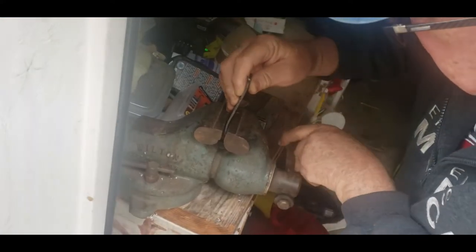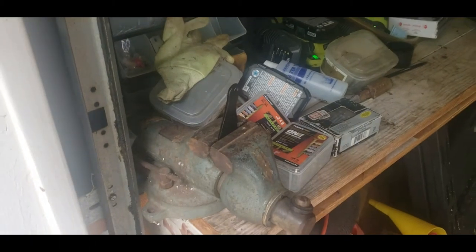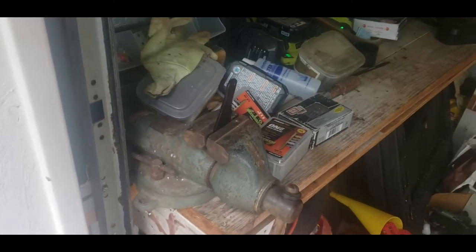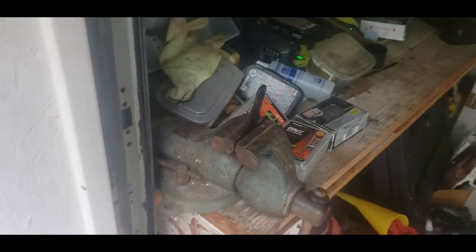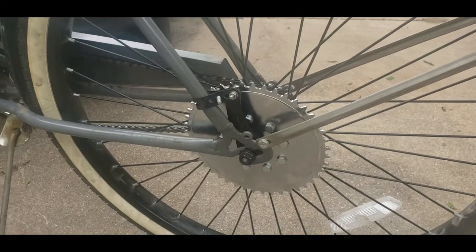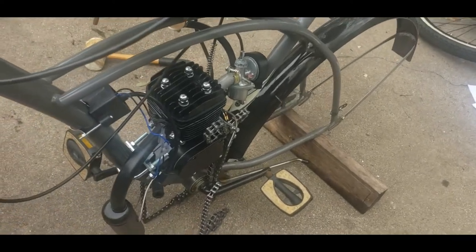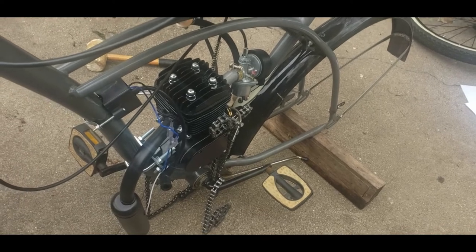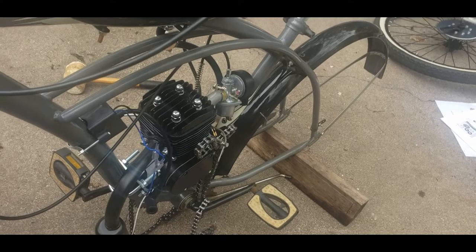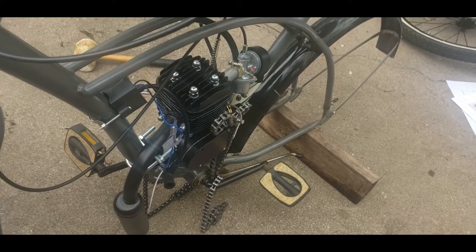As expected, we've had a setback. We're going to have to bend the coaster brake arm into more of a Z shape — this was a known issue with some of these bikes. We're leaving the Huffy Good Vibrations, which is very similar to a Cranbrook. We're going to try to bend this and see what we can do. Also we're making a chop on the fender because it's clipping against the chain. We have to cut from that notch all the way down to the bottom of the fender.